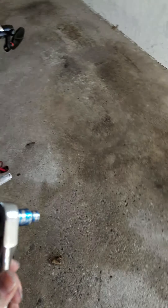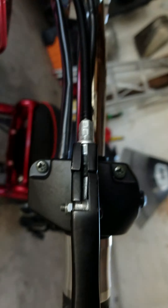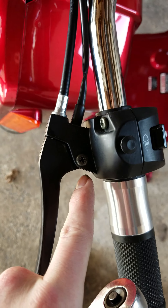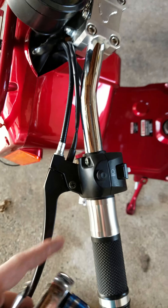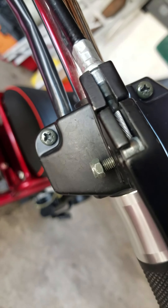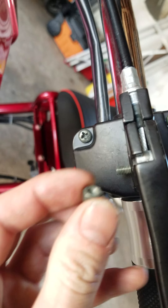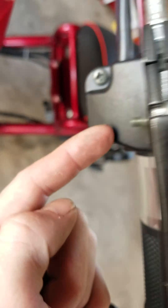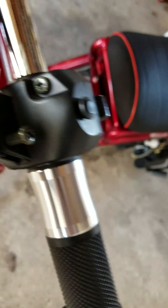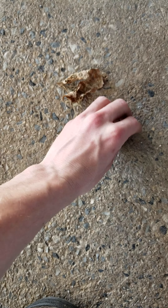First thing, the 8-millimeter is up underneath here and then the Phillips head right here. I'm gonna go ahead and take this off and then we'll jump into actually switching out the lever. I got it all loosened up, we can do it by hand now. Take the little nut off — don't lose it — and then you can just push up on it and go ahead and pull the screw out. Definitely don't lose those.